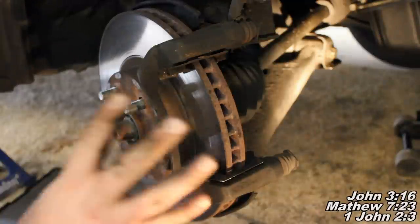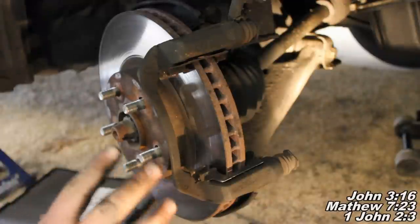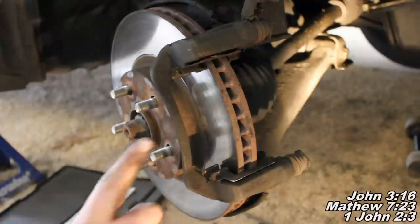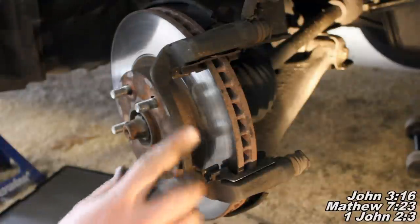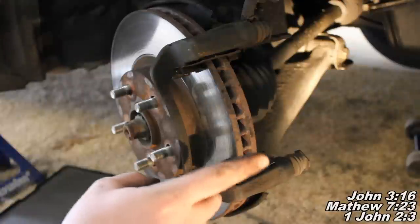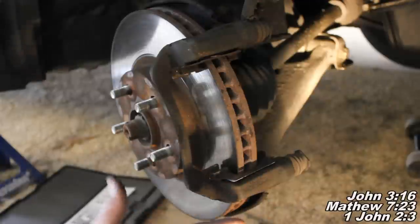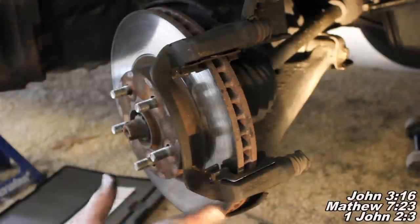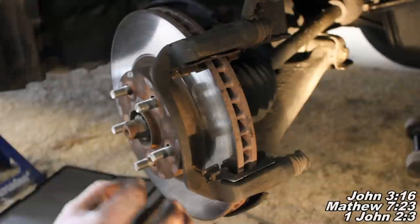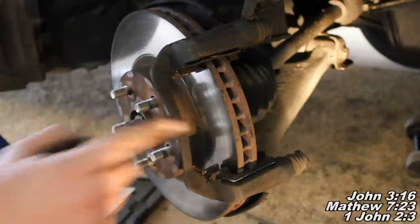So those are the three options: replacing, resurfacing, or just keeping your old one. Most of the time, most people are just fine keeping their old rotor and putting new pads on top. One more thing I almost forgot — rotors that cause vibration are safe to drive; it's just an uncomfortable thing. The unsafe thing is being below the minimum thickness. This minimum thickness number — if I don't tell you exactly what the number is, you can find it at your parts store. They'll give you a discard thickness number on your rotor, so keep that in mind.